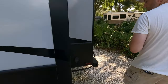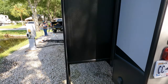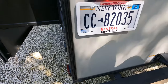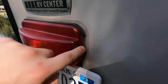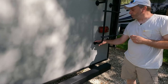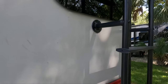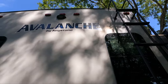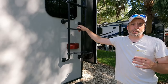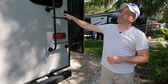Continuing around — a lot of this will be redundant but make sure those are all siliconed. Check windows in the corners — that's another big spot. Also check your lights, because I noticed here I do have to silicone this little section right here — you can see it's kind of cracked. If water comes down you don't want your lights not working on move day. Around your ladder mount make sure that's sealed. Check all the way up, and also check the top of your brake lights as well. Being up on the roof and checking that is pivotal — check all your lap sealant, make sure everything's sealed, no cracks or dips in your roofing, otherwise you want to get on that quick.